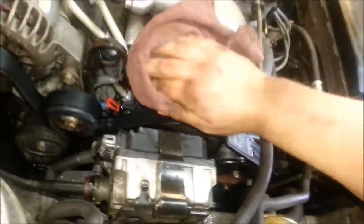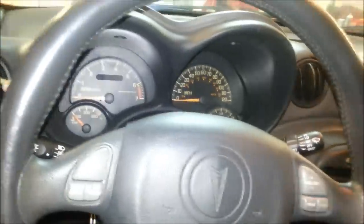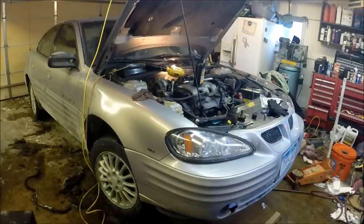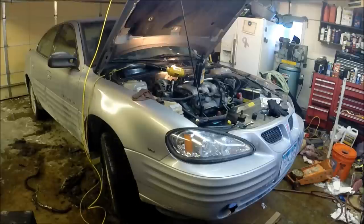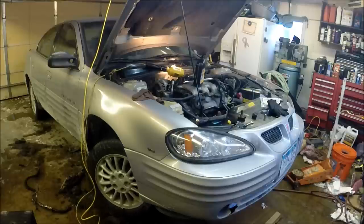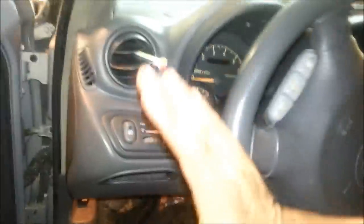If you're completely empty, fill up a good amount. Wipe up any spills if you have any. As I said, with the vehicle off, run the power steering all the way left, then right. Try to do four to five times all the way to the left and back. As you can see, we're going down, so I'm going to add a little bit more fluid.